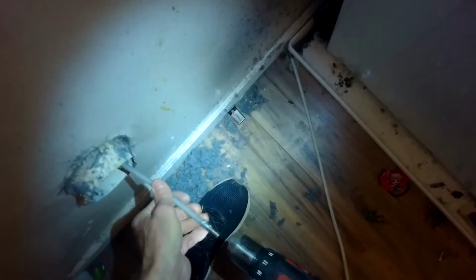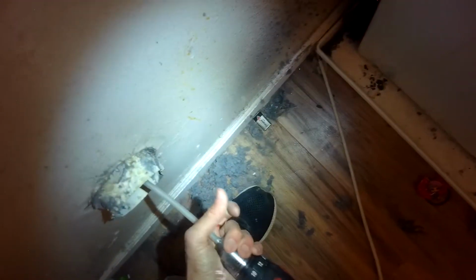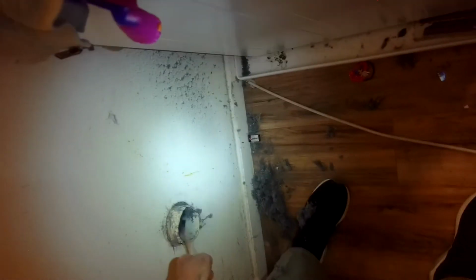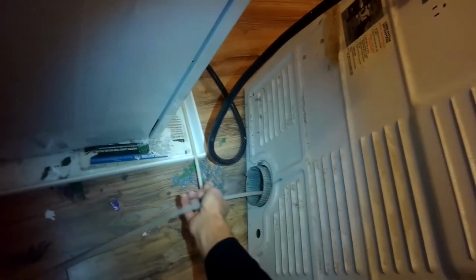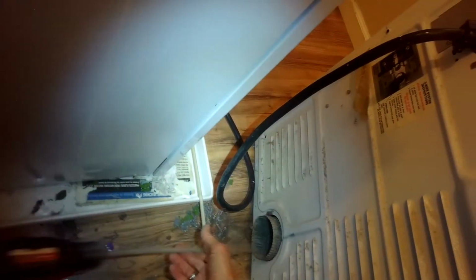If you have that type of arrangement, like often seen in townhomes or condos, you have to do this more often, maybe about every 6 months. And when you do that, when you get rid of all that lint, then your dryer works much better. It just dries the clothes much faster, like it's new. You just took a big chunk out of the back of the dryer. Cleaning out that tube also.